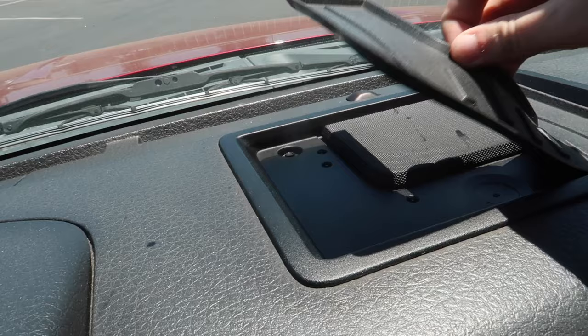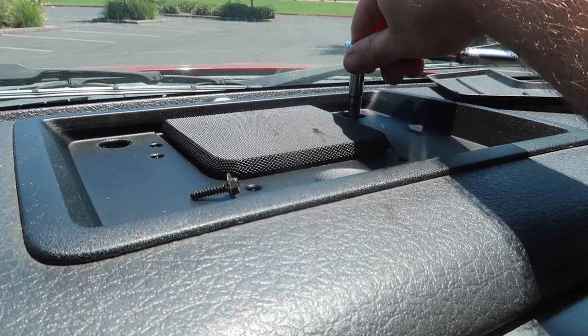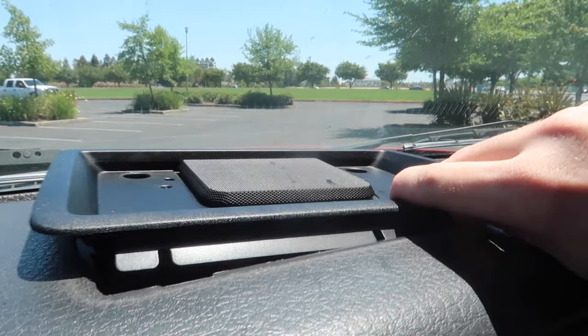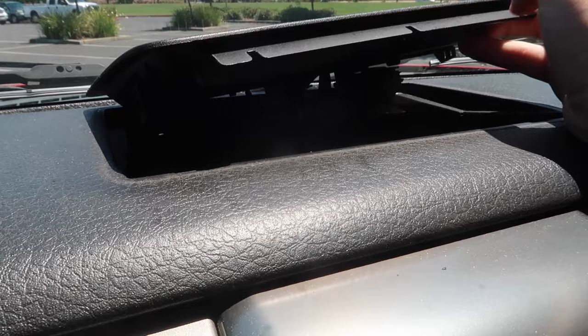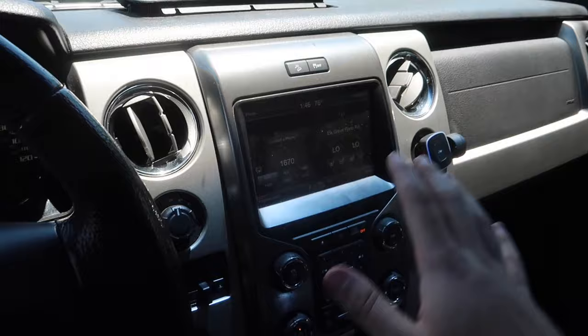The next thing is actually back here. If you remove this rubber piece and take out those bolts — they're held in by seven millimeters — then push this panel back until it pops off. Once you take this entire piece off, some of you might have speakers, some might not. For those who don't have speakers, you actually have some USB ports down here. Some models have that. If you don't have the sound system, you can set up navigation or pre-wire a radar detector right in there — USB ports and power grounds right back there.